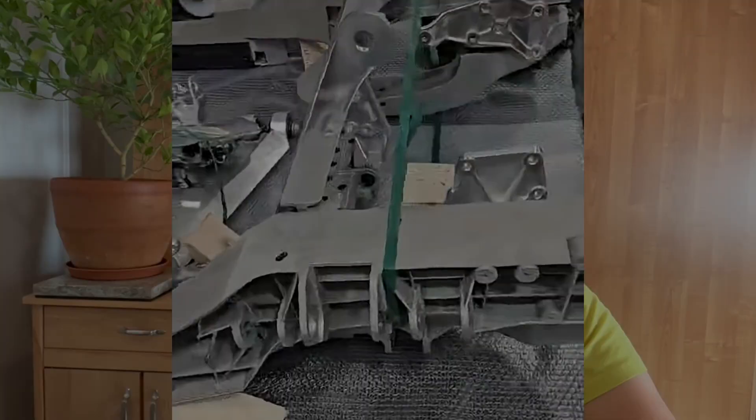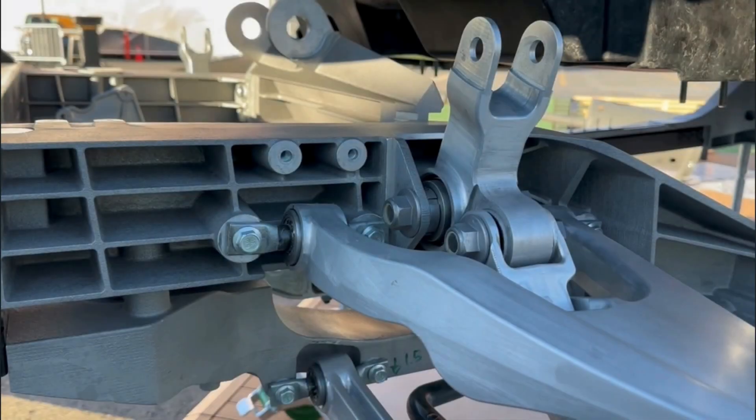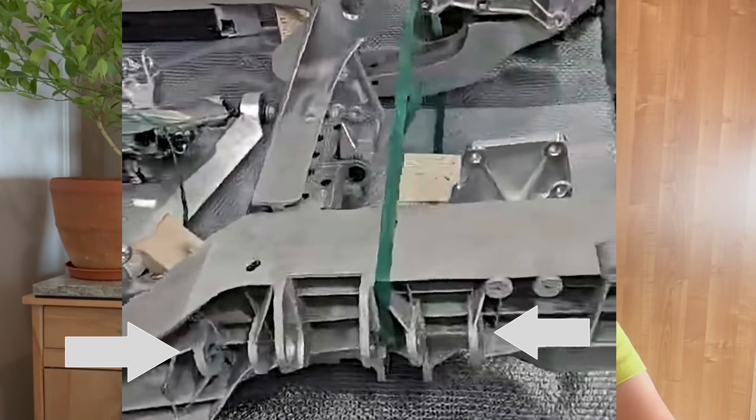Here we see the side of the front frame horn where the front suspension mounts. They've completely changed the design of how the front upper and lower control arms are mounted to the frame. The way the control arms were mounted on the static display at CES was very similar to a Lamborghini Gallardo, where the bolts went through pins mounted out of the control arm into the frame. Now the bolt will go through the frame itself — there's a tab that's been added through the control arm into the other side to another tab.